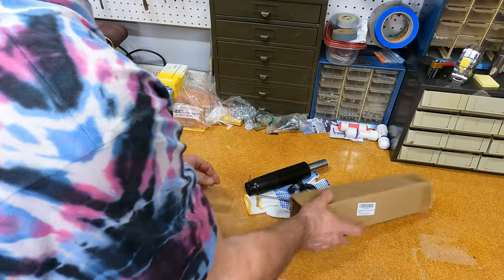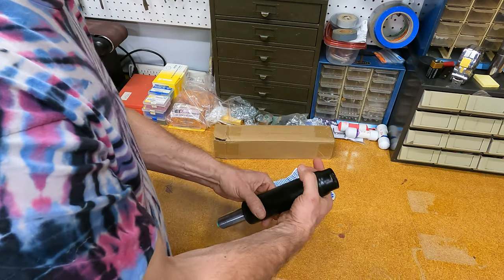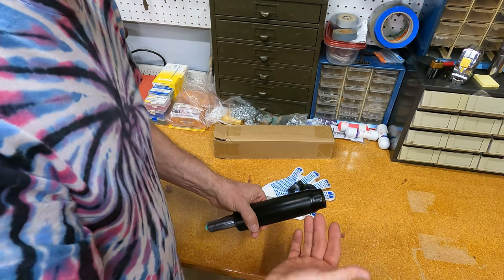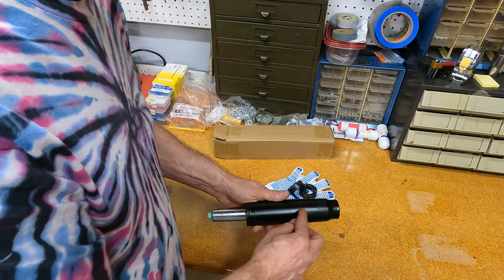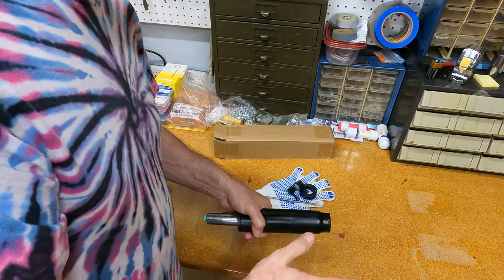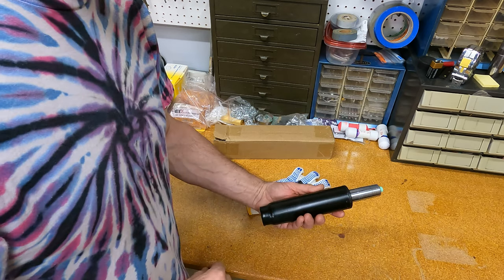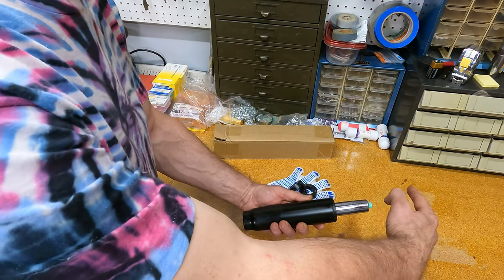Let me give you another look at this kit. It comes with a cylinder. The diameter is fairly standardized — these are around 1.9 to 2 inches in US measure, or around 50 millimeters nominally in metric, give or take a few millimeters. Don't get hung up on that because there is a slight taper; it will find its spot in your chair. Just find something very close — it doesn't have to be exact, just in the ballpark. The variable that's really different from chair to chair is the overall length of the cylinder.